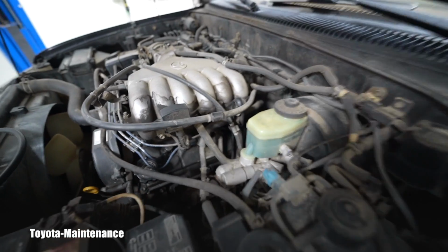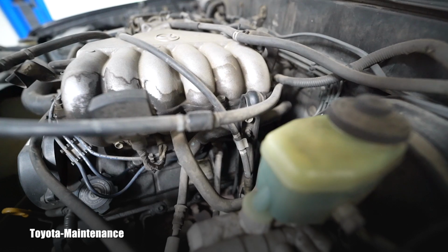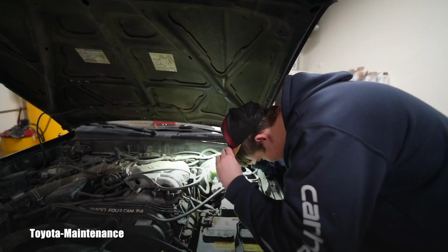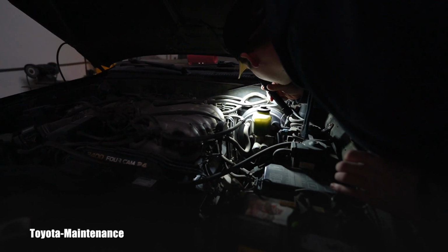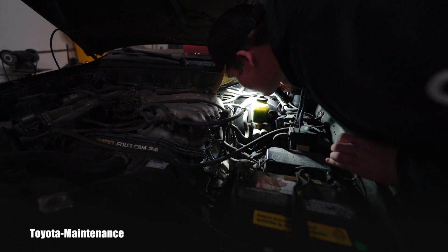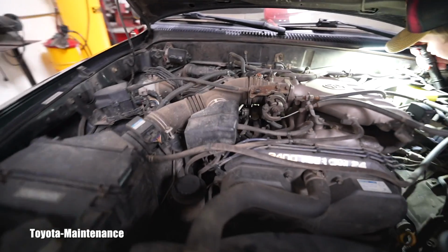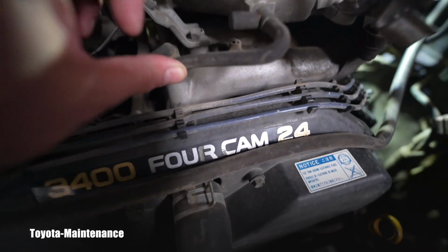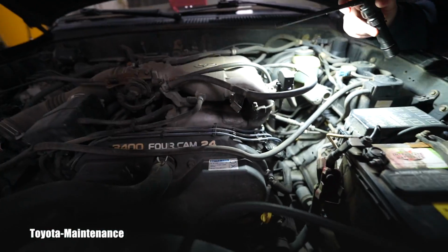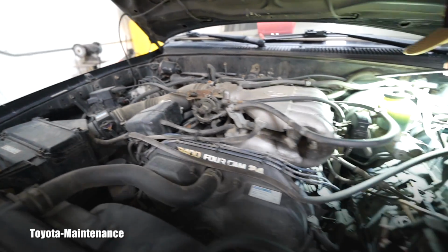So, let's bring the light again, which is in the cabin, I believe. And let's start looking to see if we have some cable disconnected or what is going on here. What we do immediately is look for something obvious. Maybe a wire is disconnected. Maybe we will see sparks shooting from incorrect insulation. We can follow it to the other side. We know there are 3 coils right here, and it's such an unusual design. There are 3 wires for spark plugs going around. So one of them could be bad. The coil should be good because it's also applying the other.